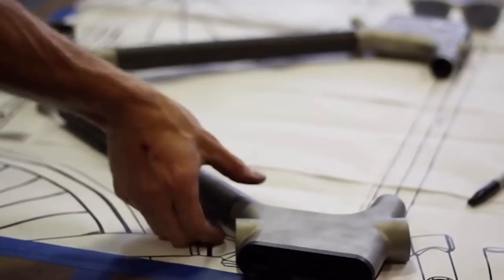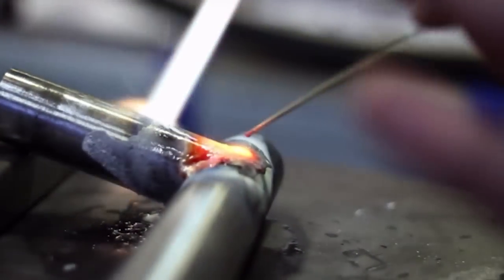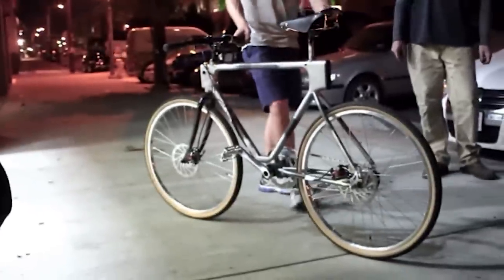We designed the whole bike in CAD for months before we ever even built one, and that made it so much easier because the transition from CAD to real bicycle was really seamless. We got to cut straight pieces of chromoly tubing and weld them to 3D printed lugs. Direct-to-metal printing is not a real household technology, so we kind of designed around it without any real-world experience — and luckily, it all worked out as planned.